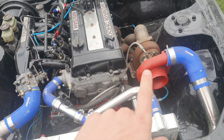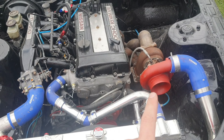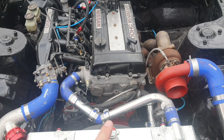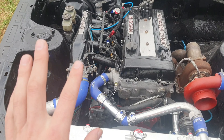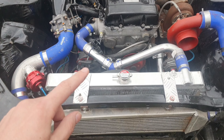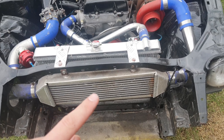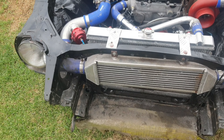The plans for the engine soon: I'd like to get a smaller ball-bearing turbo, as the GT35 is a bit big and only starts boosting at a higher RPM than I'd like. I also want to build the bottom end, fit bigger injectors, a bigger throttle body, change the fuel rail, and eventually put on a bigger intercooler.